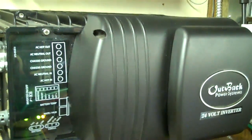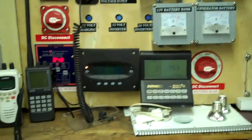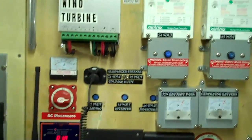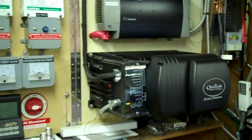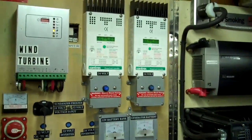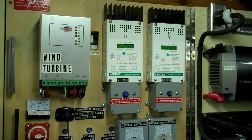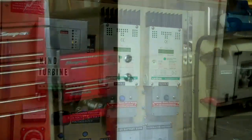And it's also grid tied. It uses all the solar that I make all year round, keeps the batteries topped off, and feeds the rest of it back into the grid. So this generator actually makes me money. Probably around $18 to $20 a month. And I'm actually getting ready to double the size of it from 1200 watts on the main array to right around 2500 watts.